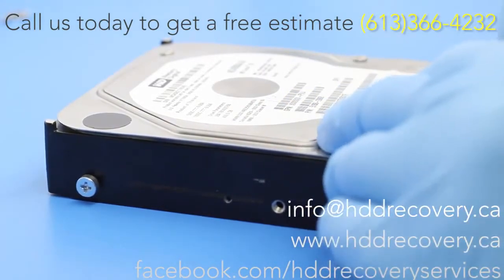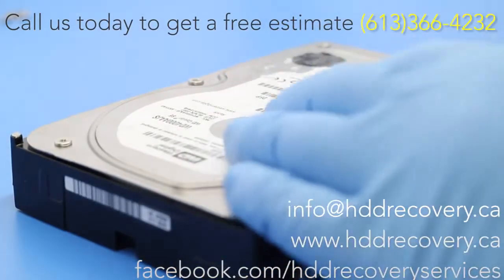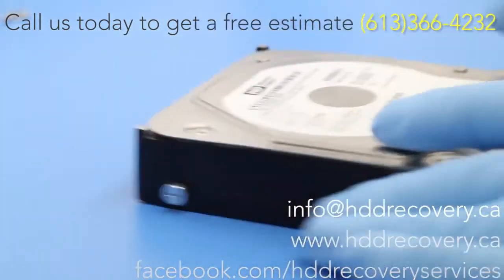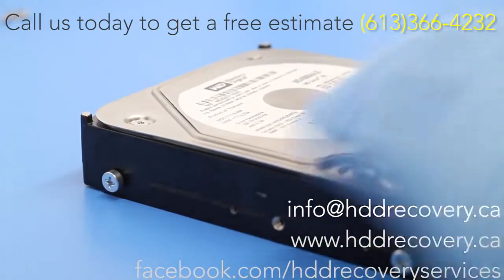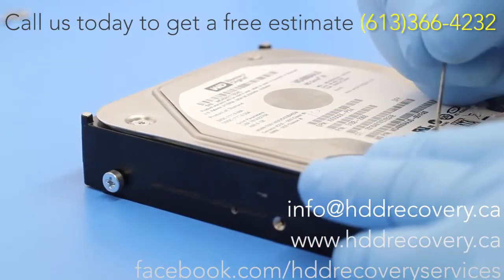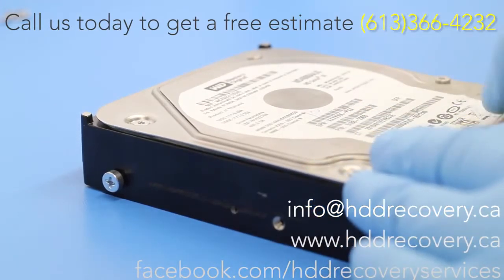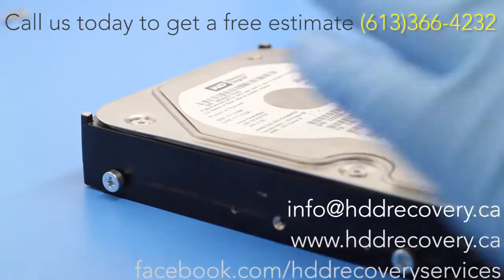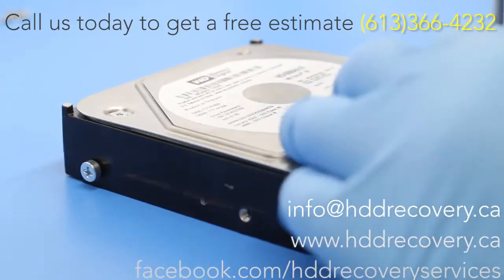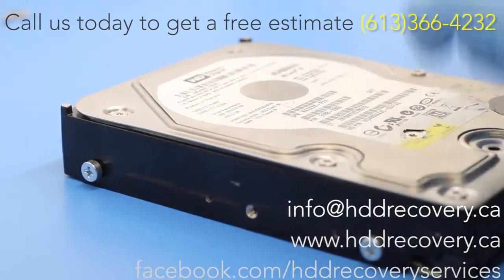So first thing, I'm going to remove all these black stickers here, because underneath them there are some screws that we're going to have to remove. And on Western Digital, there's always one screw underneath the label on a 3.5-inch drive. Well, on older ones there could be two, but on a drive like this there's only one. Okay, so I believe it's a T8 or T9 screwdriver. I'm gonna undo all the bolts here.